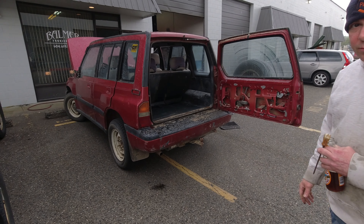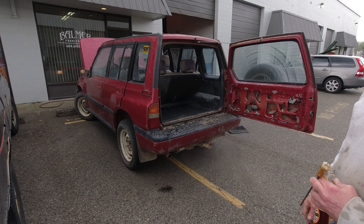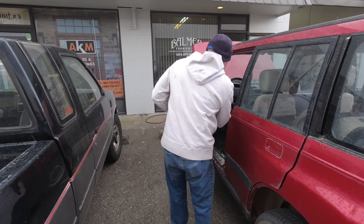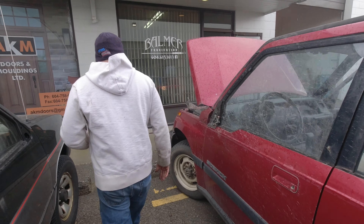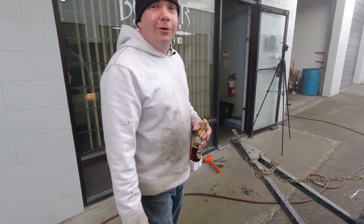It's running pretty smooth — I'm actually pretty impressed with how this thing runs. The idle has come down a little bit; it's only been running for a few minutes, but it's dropped to about 2700 RPM. We'll see what happens with that. We're just going to let it run here and let it smoke away — man, is it ever smoking.